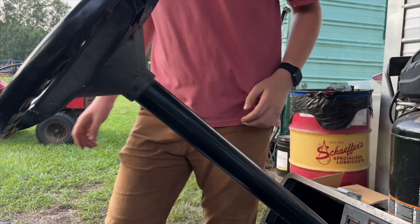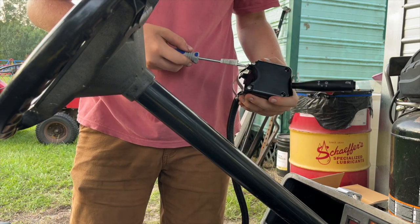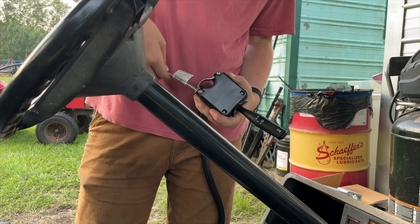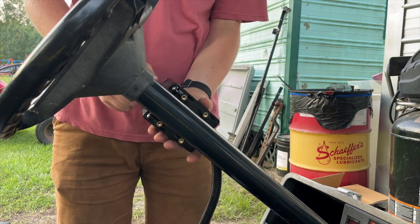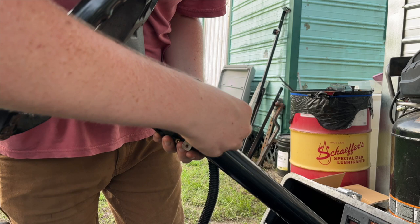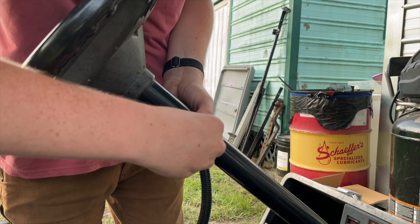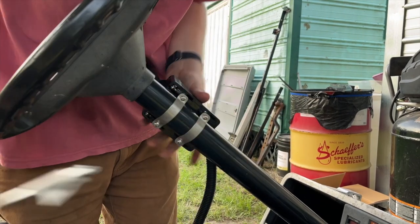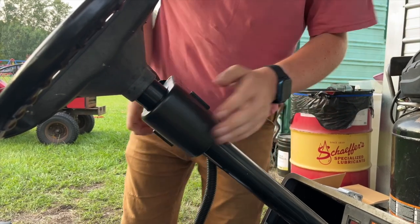The first thing I'm going to do is install this turn signal box on the dash. These just go on with two little clamps that they include, so we take these screws out and put them on over the steering column — it sits right here under the steering wheel. It's a little bit tricky to get all the screws in, but it's a nice tight fit when they're all snug. Then we'll snap on the cover they give us.